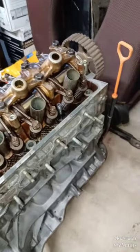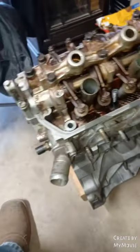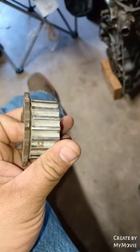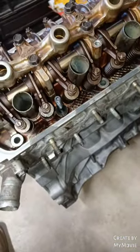I'm up to the point now where I'm going to go ahead and put the head bolts on — head gasket, head bolts, degree the cam, and then put the timing belt assembly, if I can find that one piece that goes to the gear on the opposite side. That little thin piece of metal so the belt doesn't slide off or hit the back or front of the block.